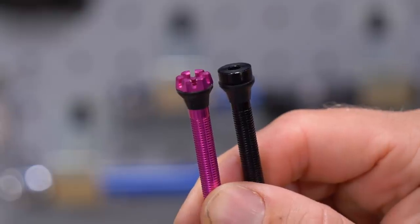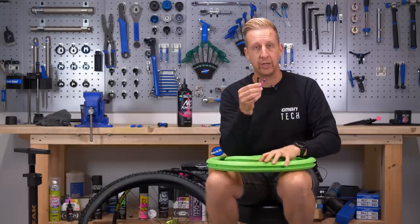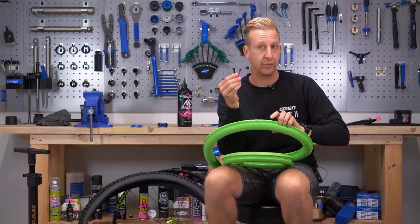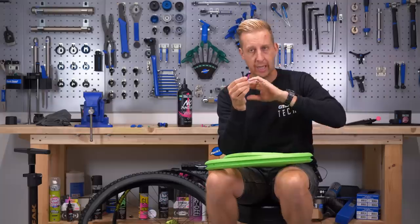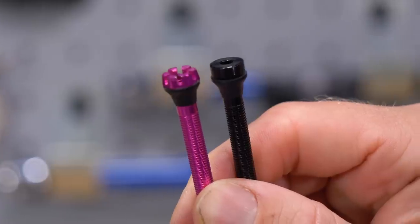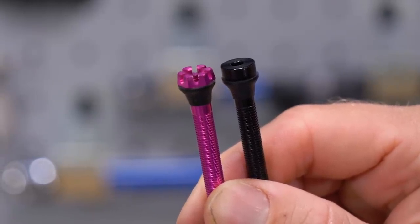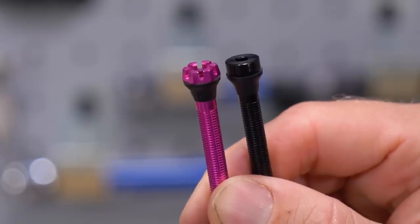The fundamental difference between a regular tubeless valve and one that's compatible with inserts is the bottom. If you look closely, the regular one only allows air to pass straight into the tire, whereas that can get blocked by the insert itself. You should be looking for one that has multiple ports on there for letting the air out in all directions. That means you're going to get the tire inflated properly every time — it's just not going to happen with one of the more conventional ones.